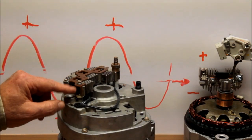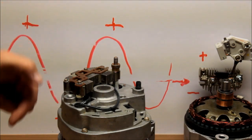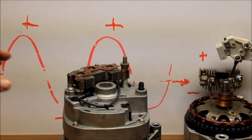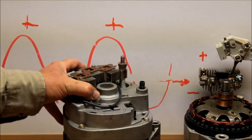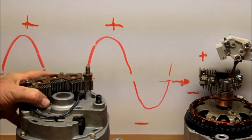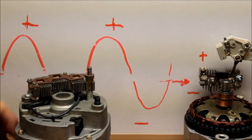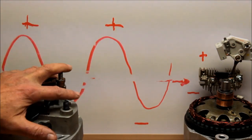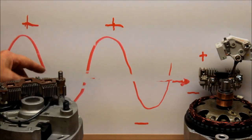When you're doing your big three upgrade, turn it into a big four upgrade and run a grounding wire from the back of your alternator over to your battery. I get all kinds of calls from people who don't understand the grounding issue. They think their ground is their battery, but your battery is strictly a storage device. Your battery does not make any electricity at all — it just stores the positive power and the negative power that is created inside the alternator.